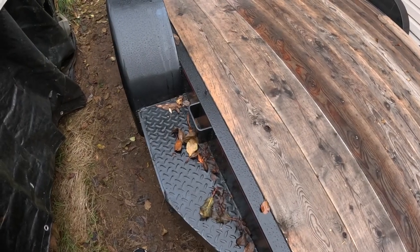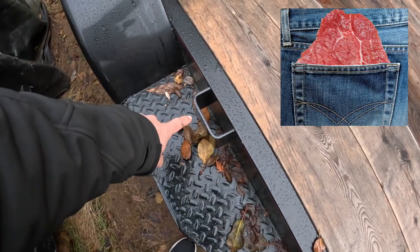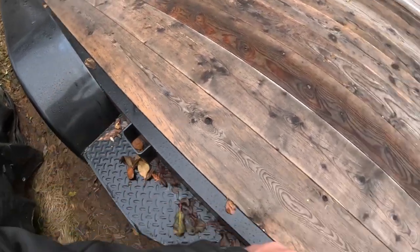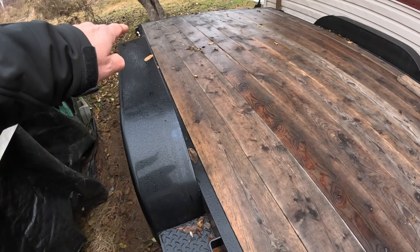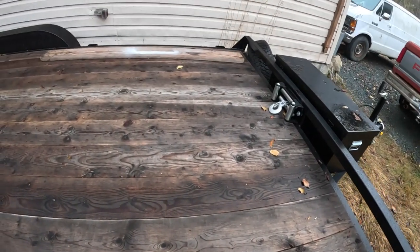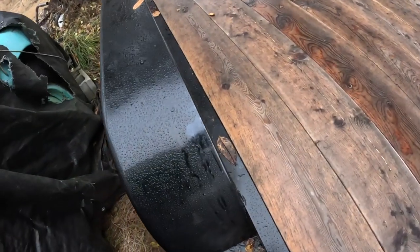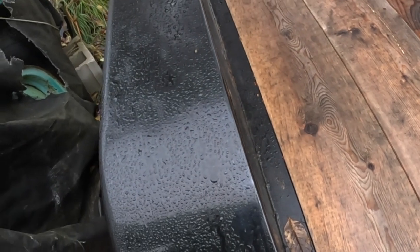What I've got in mind is using these stake pockets that are on the trailer. I'm going to do a 2x4 coming up here, run a 14-foot 2x10 the length, and actually stack two of those on top of each other. There'll be one on each side. The fenders will also act as a support to stop the wall from blowing out when I have gravel in there.